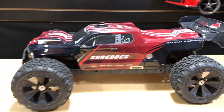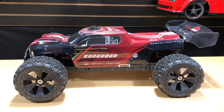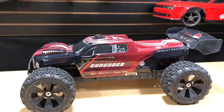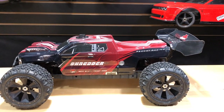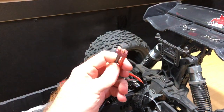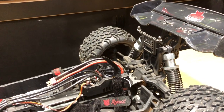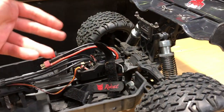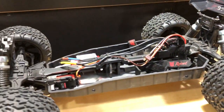At the end of the day I give it two thumbs up. I think it's well worth the $360. You'll want to get two 2S LiPos if you don't have them — and a charger. Get two 5000mAh batteries with Dean-style T-connectors and you're good to go. This truck comes with T-style Dean connectors. I currently have a single 4S LiPo pack in here, which is why you see just the one connection. Other than that, this thing has been great.